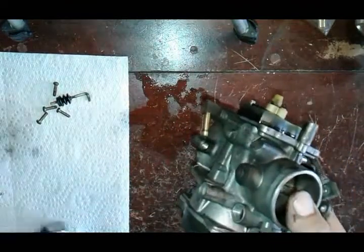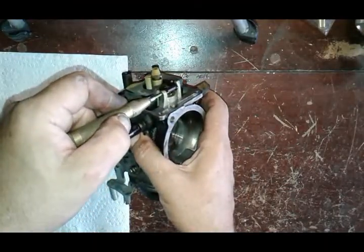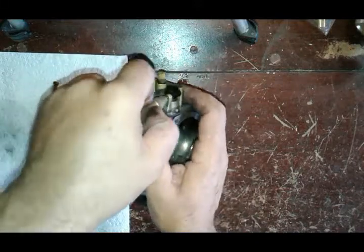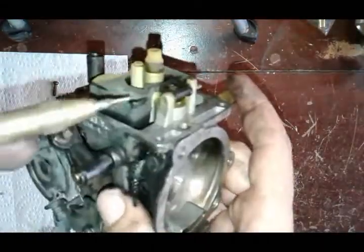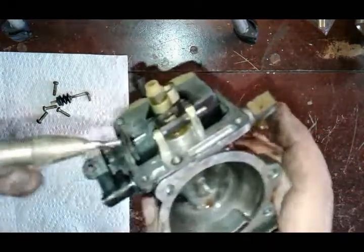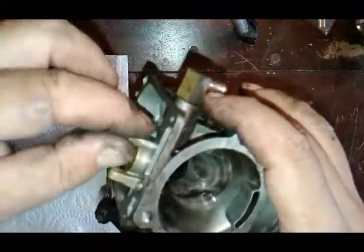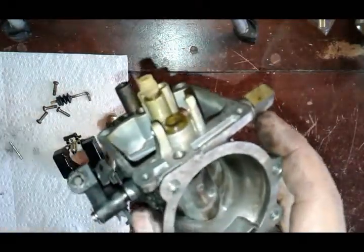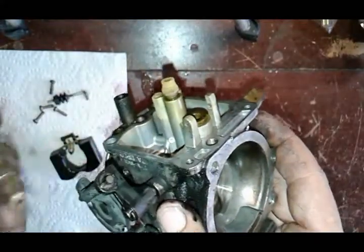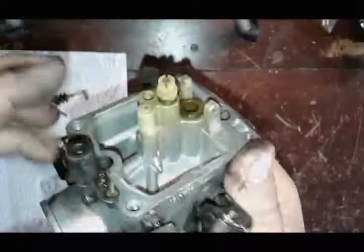Okay, that's what it looks like. Put that aside. Next we're gonna take our float needle off and our two jets. What I like to use here is a punch from Harbor Freight that I filed down a little bit so it fits inside this opening — the spring action works perfectly to knock this pin out without busting these towers. You've got to be really careful when you do this at home. I've seen many times where people break these towers and the carburetor is garbage at that point. So use something proper — file something down so you don't hit the towers.